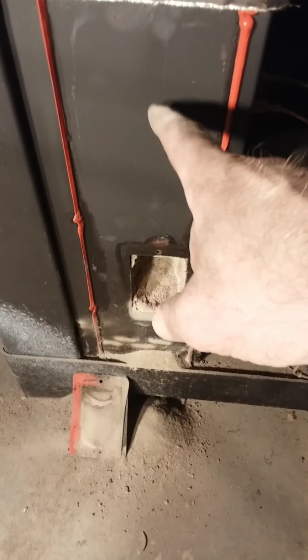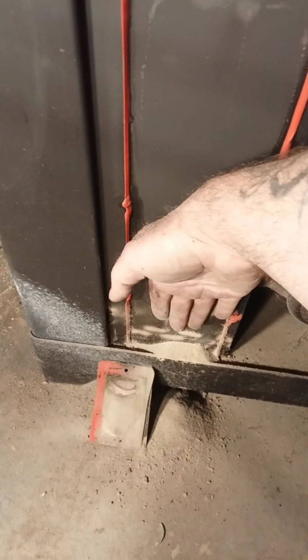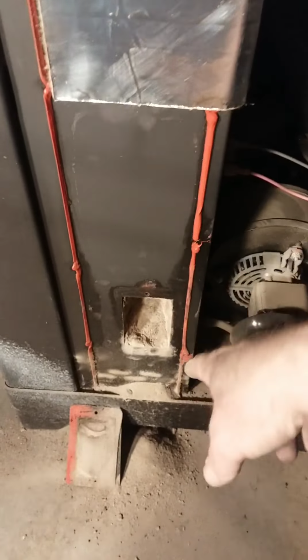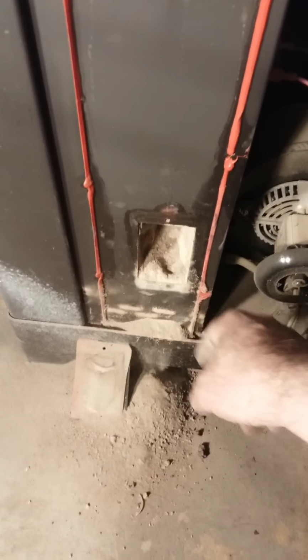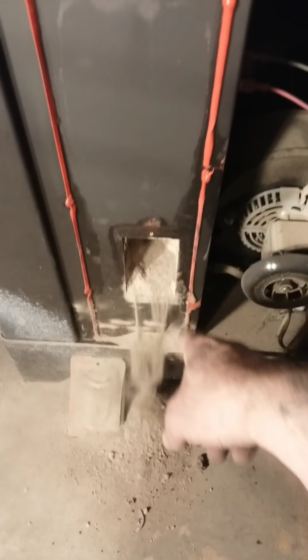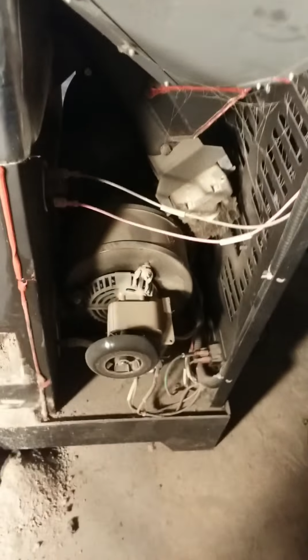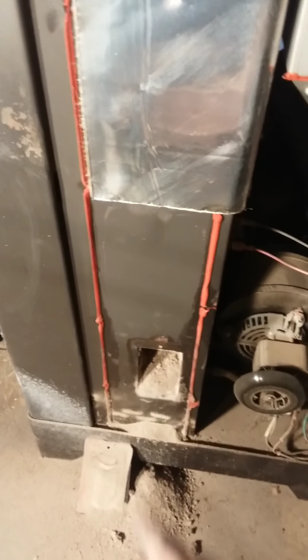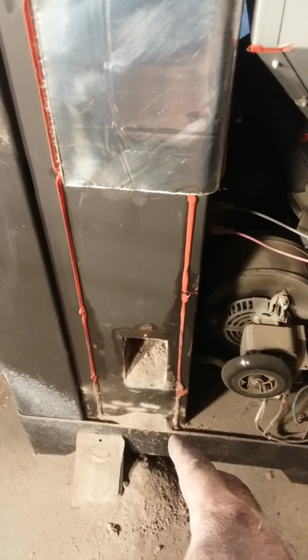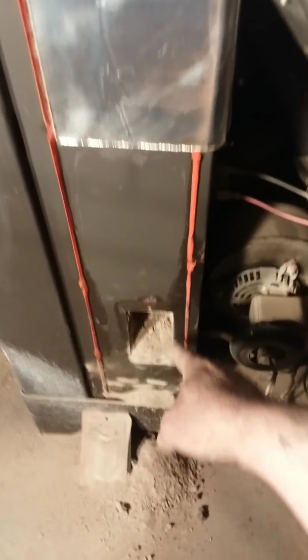So what I did was, on the other side, I cleaned it all out, started the stove up, and sure enough, I could feel a suction through there. All right, which means that that's an air chamber, and this is just clogging it up. That's all soot. You've got to get a small line on your vacuum and vacuum it all out, and the E2 should go away. I didn't test it yet, but if not, maybe I got something else wrong, but that's a start. And from what I understand, that is a cause. So I'm going to vacuum all this crap out of here.